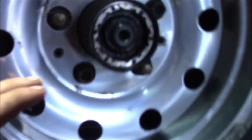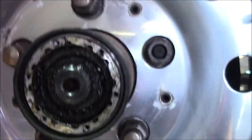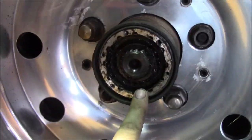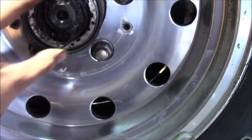So we figured out our four-wheel drive, we were having a weird popping sound when we were turning left. Turns out they have this installed wrong. So there's this spring and then the cap. I don't know exactly where I set the cap. Anyway, this spring is supposed to be behind that gear like that. So that's what's wrong with four-wheel drive.